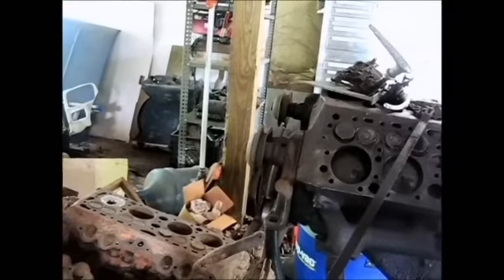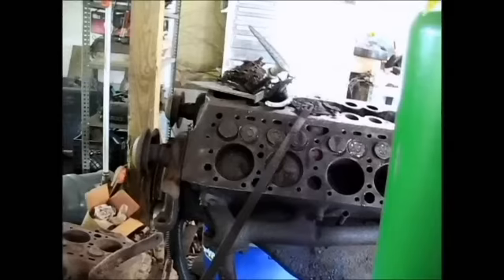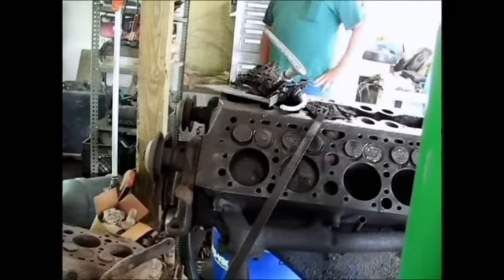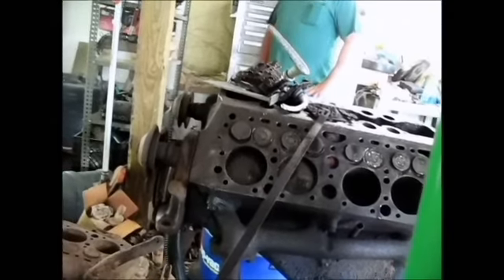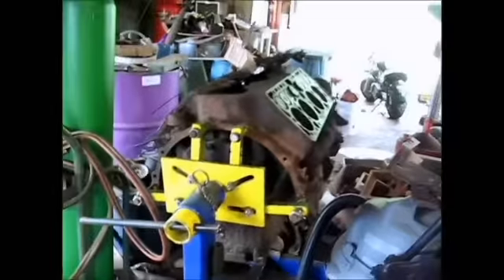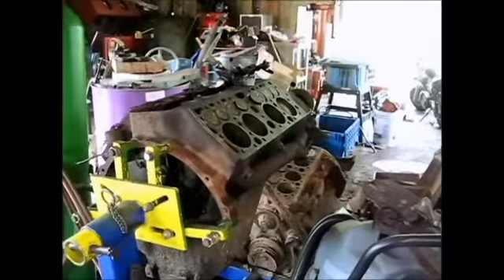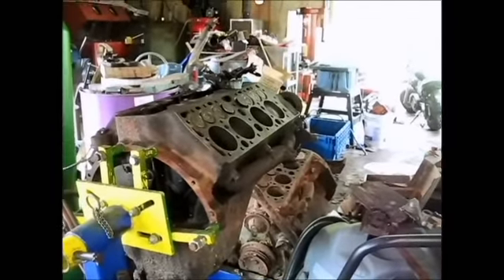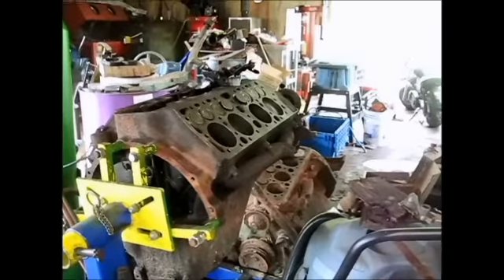Check the crank — you don't want to take the crank out. Even if you've got to turn them 10-10, that don't bother me any at all. Oh, that's going to be good. So that's why she's still smoking. But that block right here is pretty much toast. I'm glad you got it because you're the kind of person who can save it and make it work — a lot of people would just say it's too far gone. But that was sort of what we were all hoping for, is somebody to get some use out of it.